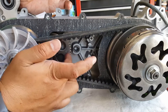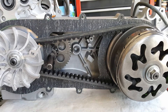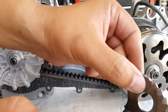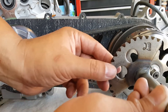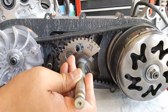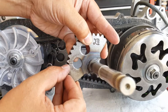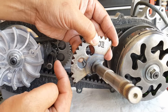Our alignment mark is still good — you can see it's straight and parallel, which is what we want. For this next piece, you can put the springs in last. Make sure that this indent mark is also facing horizontal, pretty much toward your variator shaft — you want this to face the number on the other piece. There's a block area where there are no teeth, but get it as horizontal as possible even if you have to tilt it slightly, as long as it's facing toward the variator.